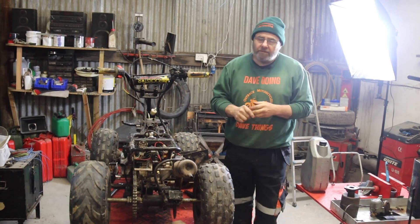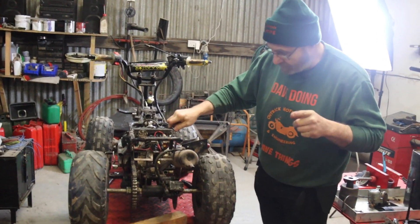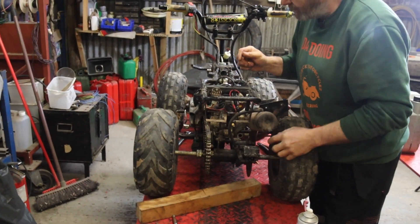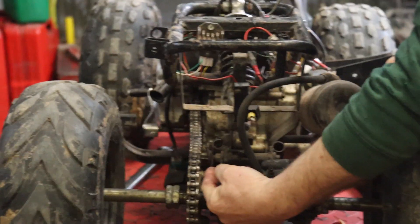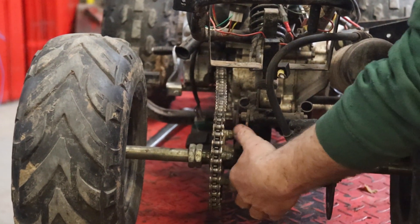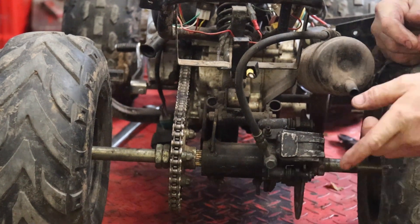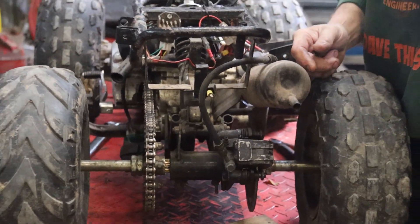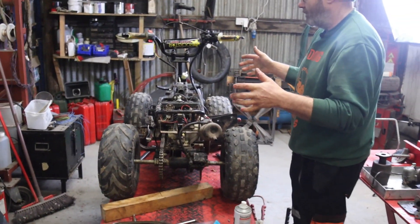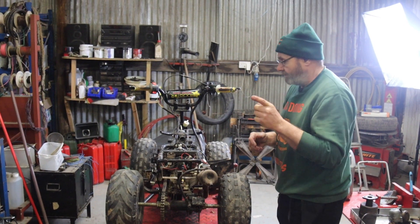You just think people are such liars. It doesn't bother me because I'll fix it, but buyer beware. He'd apparently done the rear wheel bearings, but if you look down the chain line the sprocket's in the wrong place - there's a spacer missing. This bracket should be there with a spacer in that hole. That's not a problem, I'll just turn one up on the lathe, but if you don't know that you've got to source a spacer. People bring this sort of thing to me and say can you get it going, and you won't like the bill.